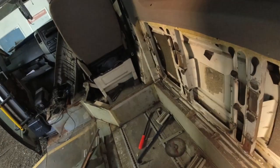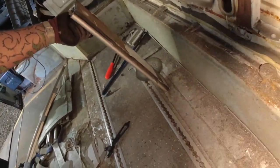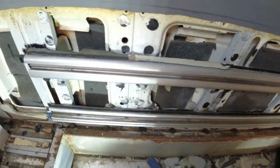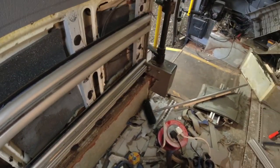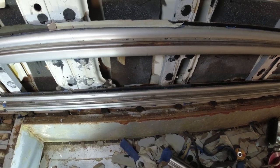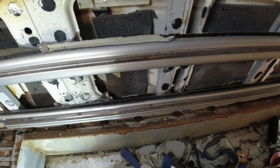Well, these sidebars for these seats are causing a real, real problem. I got the top one off, as you saw, and I've now got the bottom one off. The only problem is, I had to cut it down into sections to actually get it off the wall. And as a result, I'm using the big angle grinder, as you will see when I attack this side. And that bottom one, because you can't get underneath to get the angle grinder to grind the welds off, we're struggling. So it's coming off in sections, and I'm having to rip the welds off at the bottom in small bits. Hopefully you'll see that in a little while.